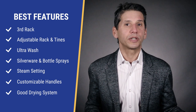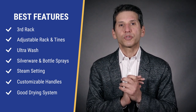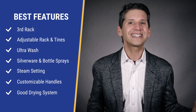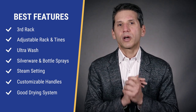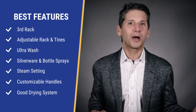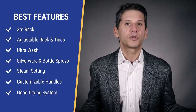The drying is interesting insofar as it is the opposite of the industry's more effective drying modes. Miele Clean Dry and KitchenAid's ProDry introduce outside air into the dishwasher, so the warmer, steamier air is attracted to the colder outside air and dissipates as water. A number of brands automatically pop open as well to release excess heat and steam. Cafe does the opposite — it uses a heating element to dry, but also a fan to pull the steamier air outside the dishwasher. They claim it dries plastics even faster.